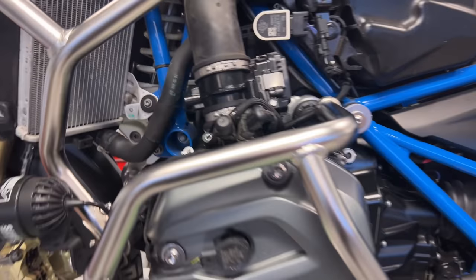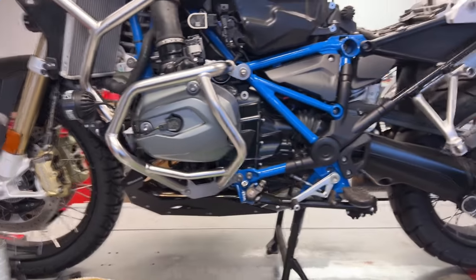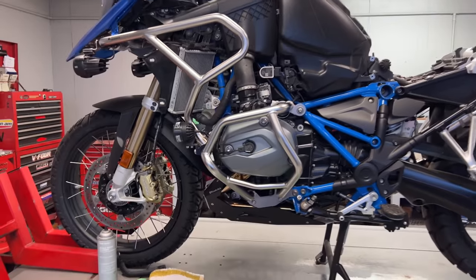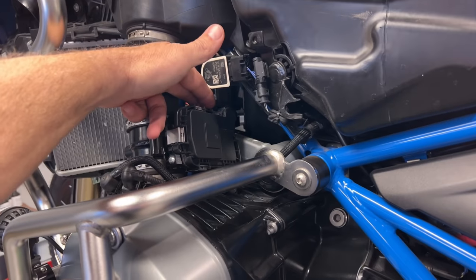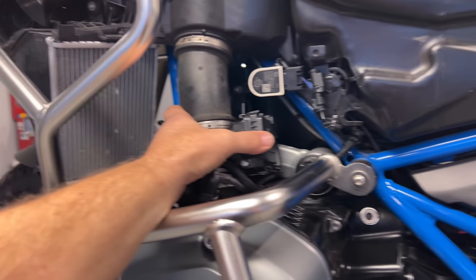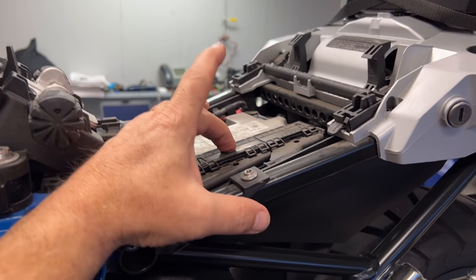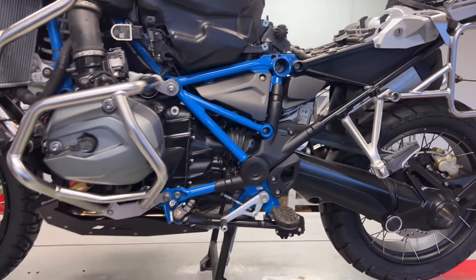Anyway, going back together with this, I submitted a long case file with photos and stuff of this thing to BMW, see what they think. I've got all the pins on both throttle bodies. I think I was showing you guys it was the left-hand one yesterday. Maybe it was the right-hand side. I don't remember where I was. So luckily the DME is very easy to get to. They want those pins cleaned as well.